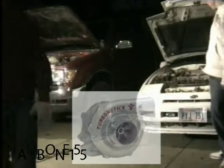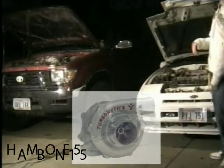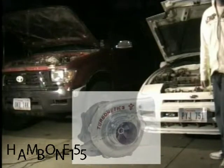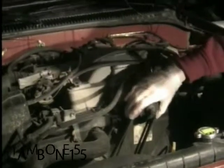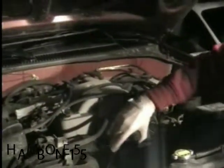And also turbocharging — if there's only one, it works off the exhaust. This right here is the supercharger, and basically how it works is it's driven by the belt, which is really hard to turn. The air gets pulled in from the air box, through the mass airflow sensor and throttle plate, into the supercharger, which pressurizes it like an air compressor.